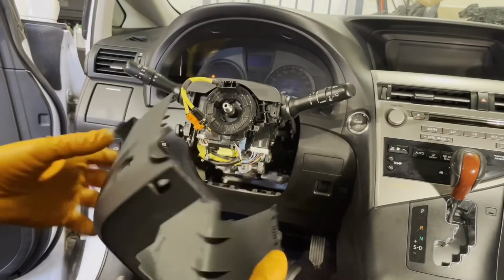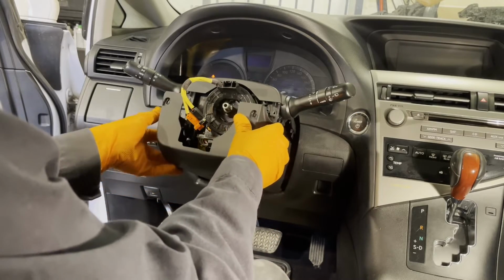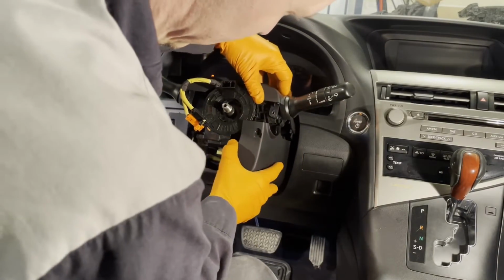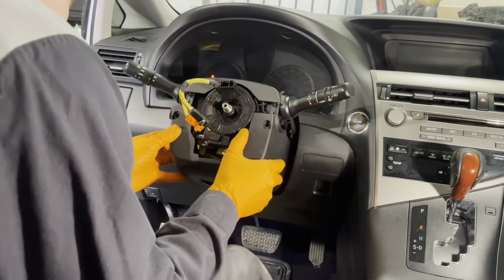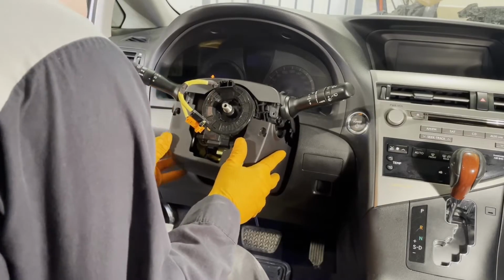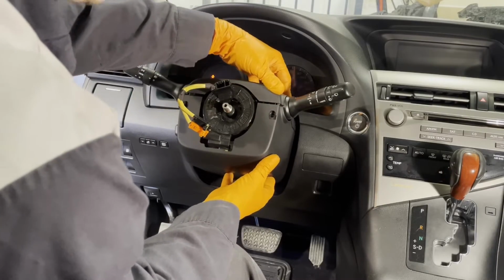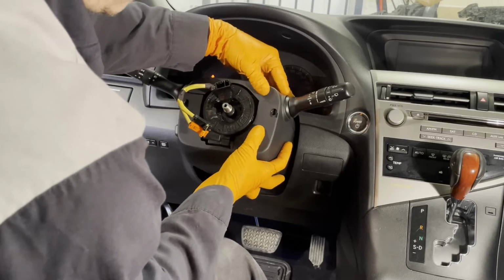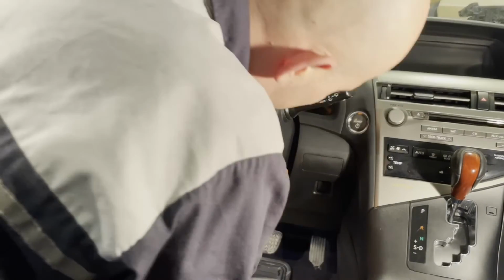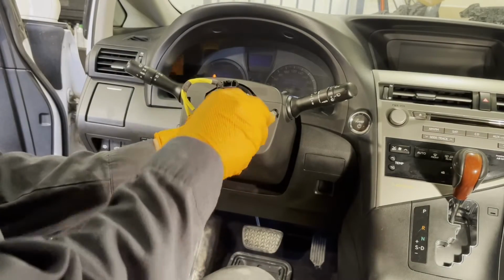Now we have the bottom cover, so just got to get the tilt switch in through that hole. And now line both of them up. There's a lot of little tabs on them, so they all need to click in properly. But don't force it. It should line up nicely once everything's aligned. And then clip the sides in together. Okay, that's good. And reinstall the 3 screws.